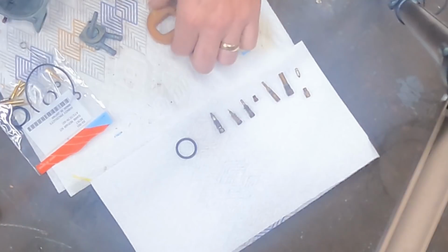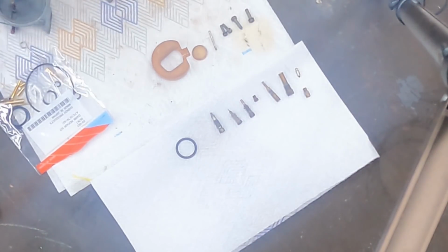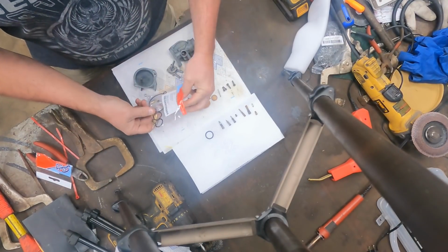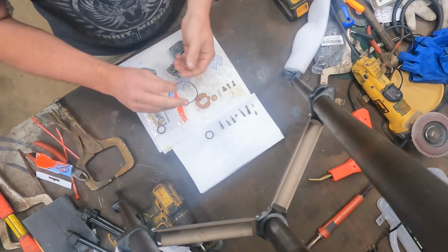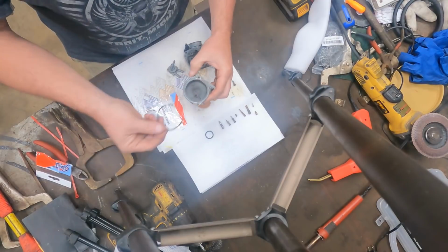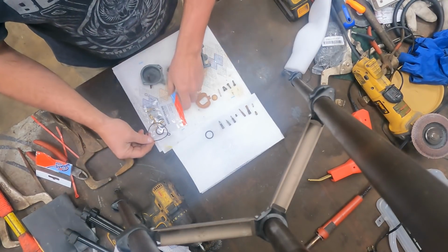So these are the parts that we're going to clean up a little bit more. They're a little dirty. These items are all clean. So here we go. Not going to spend a lot of time with this. We've done carburetor kits in the past. The most important one, well, I shouldn't say important, is this gasket here. This one is really bad about leaking, especially when it's been taken on and off several times over 30-something years. That's your bowl gasket. Last one really to be put on.